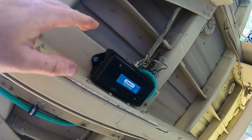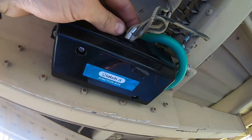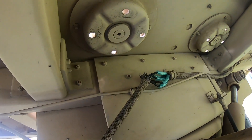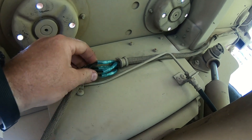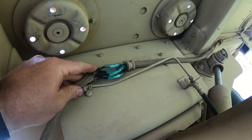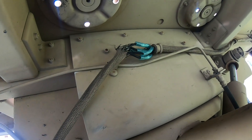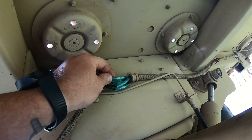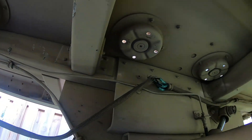We're going to close this up and come back to it later — I've got more stuff to add to convert it over to 12 volts. The box being on it protects it from water; I will end up coming in and putting some silicone around it when I'm completely done. Moving back, as you saw earlier we had some wires that had gotten ripped out. We've gone through and tested each one to make sure we have the right setting — they are all just a black coating so it's really hard to tell what's what. I had to go in and pin out each one going from front to back, put voltage on it, and make sure everything works. These are heat shrink — I just need to come back with an actual heat gun and shrink them down, then wrap with tape and get this wire re-secured.